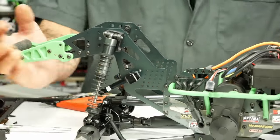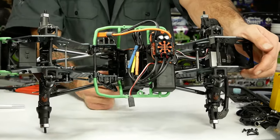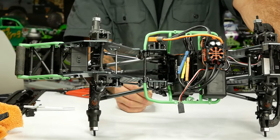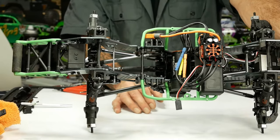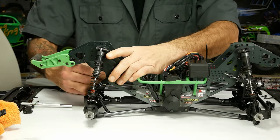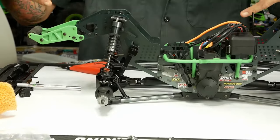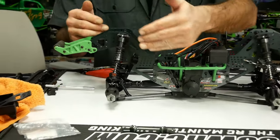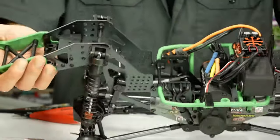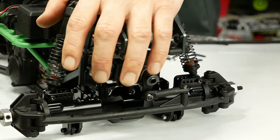Basically swap, hook that up — fairly easy install, nice and clean looking. There's nothing wrong with the front sway bar either; you might break some of those piano wire rods but you can buy a pack and change those out on the trail pretty quick. This rear one is pretty sturdy — I'm not concerned about seeing it break. I would have run a shaft through the middle and shared the load over both bearings equally instead of having most of the load outside the bearing, but it works good. We're gonna put the battery box in, hook up those links, and pretty much call it on this build. See you guys in the next video.